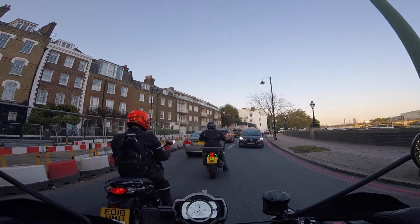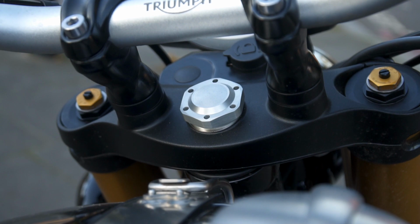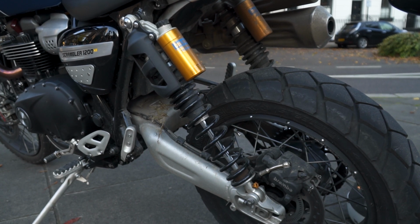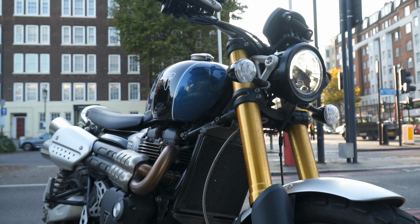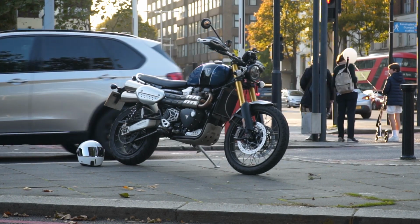The nature of the motor really complements the rest of the bike well. It's a big, tall, wide machine and deserves a tractor-like motor that you feel could get you out of any situation. The Scramblers are both well spec'd with fully adjustable Showa forks and Öhlins piggyback shocks, but the XE has a slightly more robust off-road bias setup with 47mm forks to the 45 of the XC, and both front and rear have 50mm more travel at 250 rather than the 200mm of the road-biased XC.